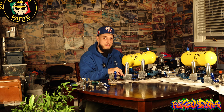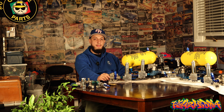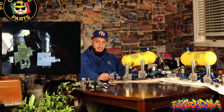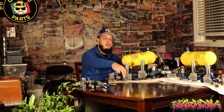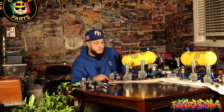I wouldn't use a Hydro Air round body on a gate setup because gates hold a lot of pressure and the round bodies are usually cast — the walls are thin, so they'll blow under that pressure. If you go with the Hydro Air green monster, that's a number twelve port all the way around — that's probably one of the best valves out there. It has a manual valve so you can release pressure without going inside the car; you just push the button or lever and it'll free-flow dump.